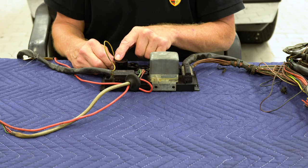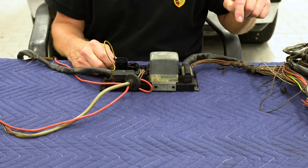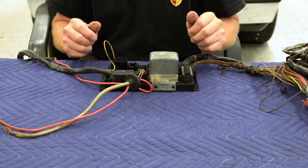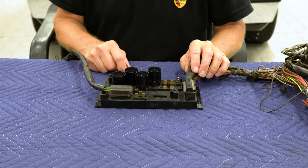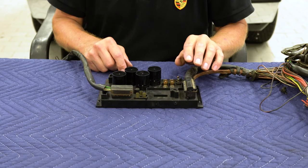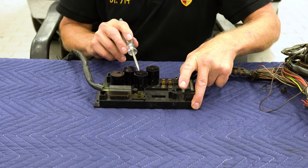The rear blower motor is now in the engine compartment; the early cars had the blower motor mounted on the left engine shelf. Now I'm going to show you a simple test to check for fuel pump operation. That is the weak link in the 1.7 and 2-liter fuel injection system. The fuel pump stops running, nothing happens, you're stranded on the side of the road. Usually it's because either the rear 25-amp fuse loses its connection, or one of these relays corrodes or goes bad.